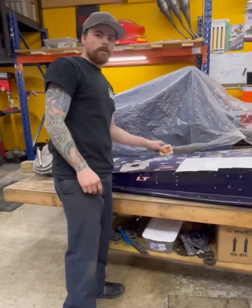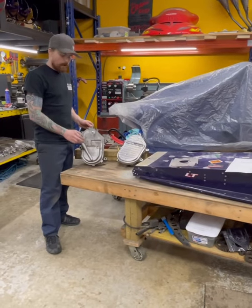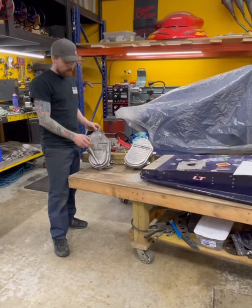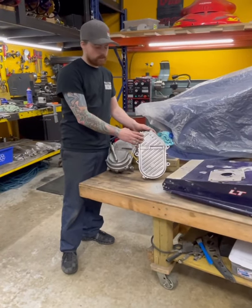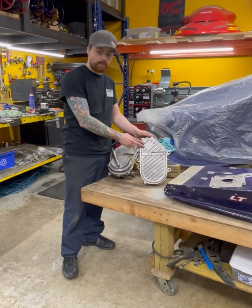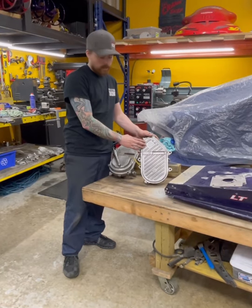Of course it comes with a sticker too. Here's the difference between the two chain cases. The stock CK3 chassis — 98 to 03 — is what this fits. The chain case is a little shorter, so you're allowed to put in a ZX chassis 99 to 03, or a 04 to 07 Rev chassis. The only one that doesn't fit is a 2003 Rev — be careful with that.